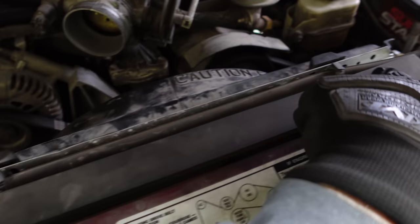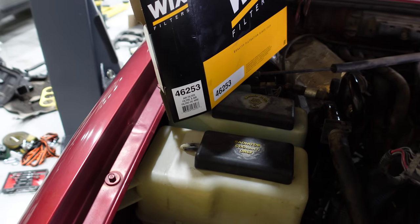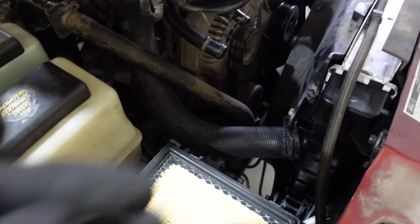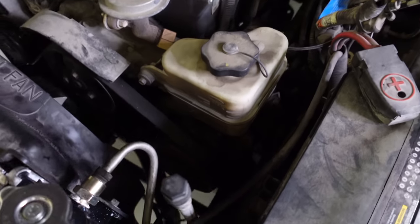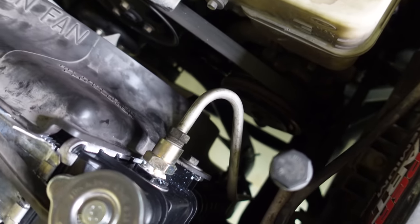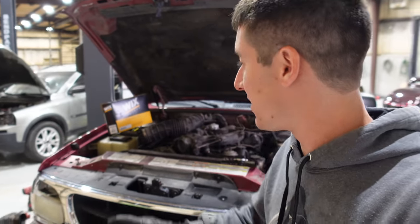I had to go pick up new Christmas trees to put in the little air dam there — we've got that done too. We've got our new Wix air filter right there, that is a 46253. It just sets right in there and then the lid drops on it. You can see the new Gates hoses in there, and there's a new lower Gates hose. The transmission cooler connections have all been cinched up — you don't have to really tighten those down too much, just get them seated and then hand tight and give them just a little bump and they should be good to go.